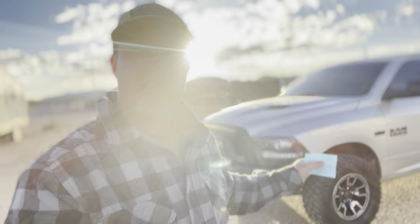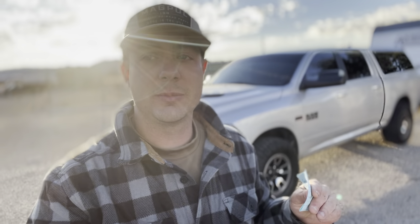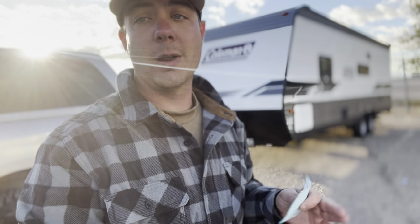There's a big debate out there whether you should get a diesel or just pull with your gas truck. I have a pretty good time with my gas truck and I'm pretty sure I save money over what I would with a diesel. As far as fuel economy goes, eight to ten miles per gallon is what I get pulling a 30-foot travel trailer. If I had something a lot smaller, it would probably be better. Don't go into towing with a half-ton expecting great fuel mileage — there's a lot of drag and force you're hauling around with that truck.